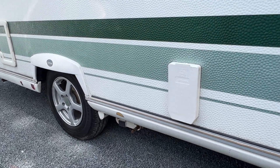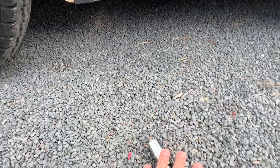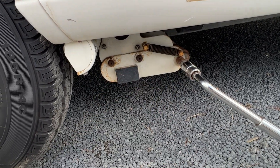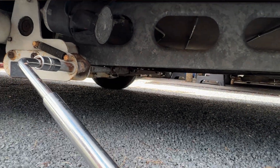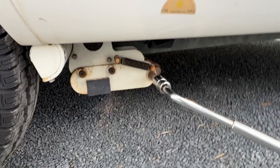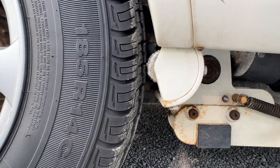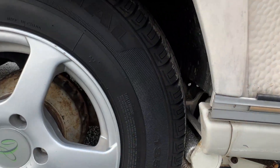But first, we need to connect the motor movers to the tyre — that's what this handle here is for. On this particular model, we only need to engage one side. There is a bar that goes the entire length of the caravan, which connects to the motor mover on the left-hand side of the camper. We're going to grab this handle and turn it anti-clockwise. You'll notice that as I move that, the motor movers move in and out. We need to crank that right over as hard as you possibly can.